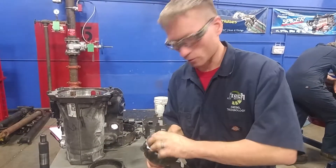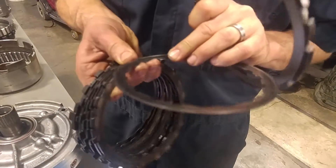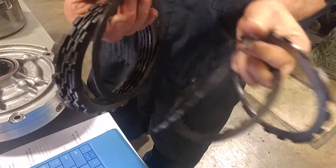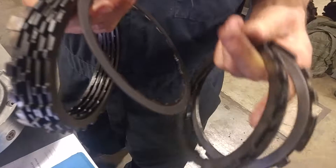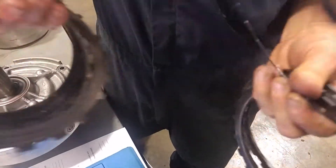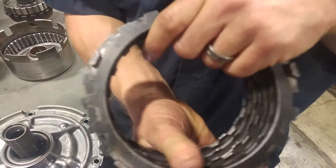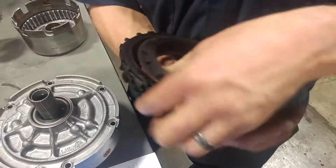See how easily that comes together and comes apart. These have different types of clutch packs — they have the thrust washers and friction washers. This one here has no friction material on it at all anymore, so this one is burnt heavily. This one here has very little friction material left on it — it's heavily worn. So this one would definitely require replacement through rebuilding before putting this back in a car. This is just a shop example, torn apart for students to take a look at and learn some of the pieces. Look at the outer teeth for any that are bent or broken — same thing on the inner teeth. These start wearing down right in the little curves — you can see it's starting to allow axial movement, which wears out the clutch and the gear, causing slipping gears.